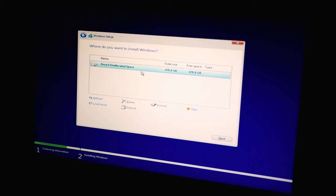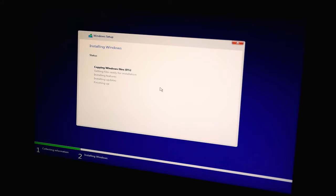Press Next and you're off to the races. After the first reboot, take the flash drive out and let Windows completely install. Run Windows updates to get as up-to-date as necessary while under a clean OS install — you'll have the best chance of successful updates at that point. And you're ready to rock.